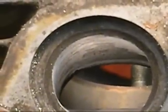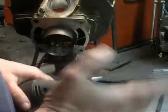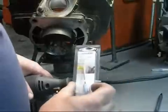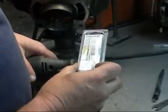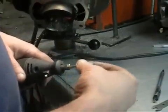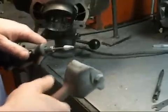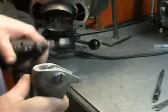That is about as clean as it has to be right now. I took my single cut carbide burr out and I put in a bluestone. That is one of these. We talked about the part number - number 82277, one-fourth to one-eighth shank bluestone. These things kind of get worn out, they will get divots in them - little spots that just aren't going to help you make things flat. This is a wheel dresser - MSC, or if you have one already.